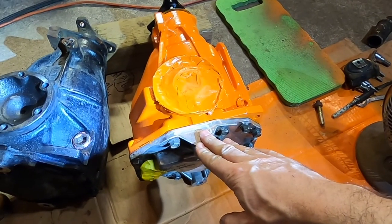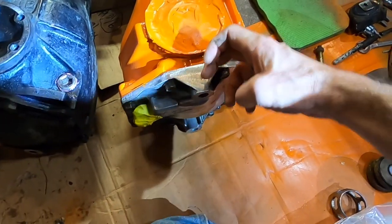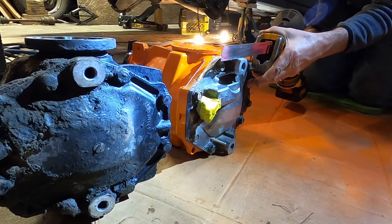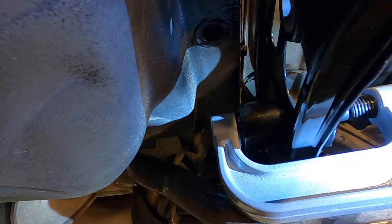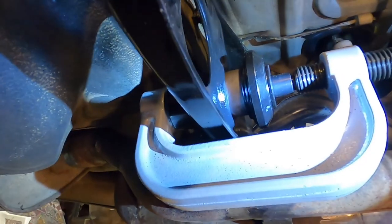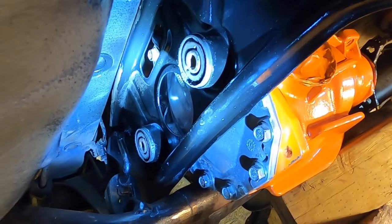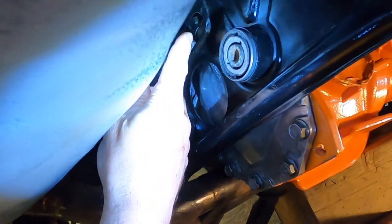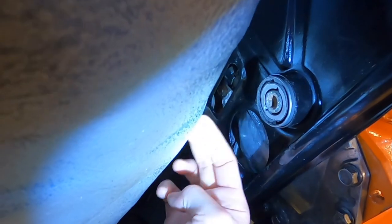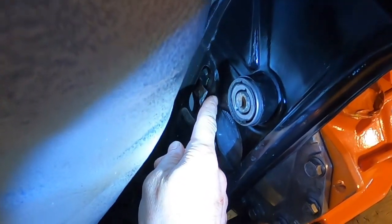There's another discrepancy between the differentials — this is actually why I'm fighting the front mount issue, because this mount point is different. It sticks out a whole lot more on the new unit than it does on the old one. Here it is with the mounts mocked up. I'm just getting ready to mount up the new differential and finishing up pressing in the last new bushing and painting everything up a little bit under here. I've got it mocked up in here, but the vent housing leading up to the vent slot sticks out more, so I just have to take this back out and cut, bend, and weld in this area to make some clearance for the housing.